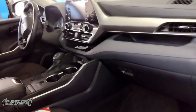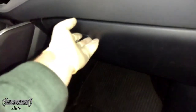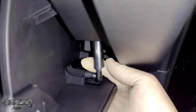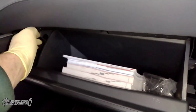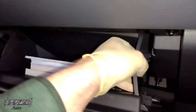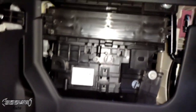Come inside the car — the cabin filter is located behind the glove box. Open your glove box and remove anything in it. There's a little plunger you have to pull off; it can be kind of tight. Then take both hands, squeeze both sides of the glove box, and lower it — squeezing tucks in the tabs on the side so you can lower it all the way and pull it off the hinges.